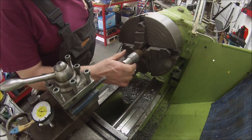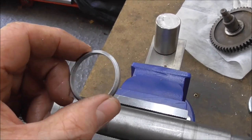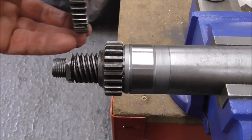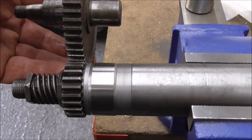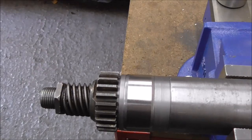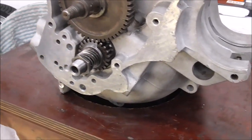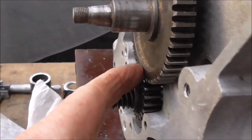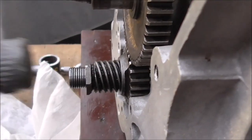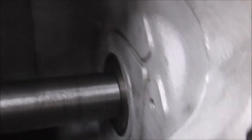Test plug just slides in there. What we've ended up with there is a spacer that's very similar to behind the pinion on that other engine that I put together. With the assembly built up when the gears are together, it misses that chamfer - even with any little bit of misalignment it misses the gear teeth. So we'll get that put in the crankcase and see where we are. There we are so far - at the moment still the nylon bush in this side but with our spacers in and our gear set up so that we are in line on the gear teeth. The temporary crank is right back to the bearing on the inside on its shoulder and we've got our spacer pieces on that side.